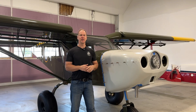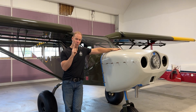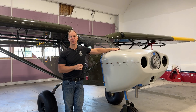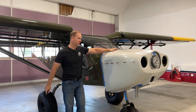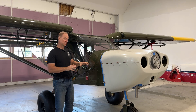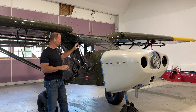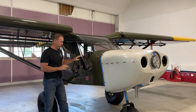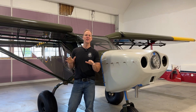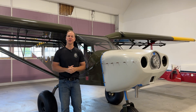When I remove the cowling we'll also talk about the oil pressure and fuel pressure sensors, which were not indicating correctly — I had one wire wired in incorrectly. The oil temperature sensor was a nightmare to get working because it wouldn't ground with the engine. Hopefully the info I give you on that will save you some headache. We'll also cover everything from the firewall back: wiring for the intercom, the windshield is on and sealed, the doors are done, I did have to remove and modify both doors, the rear seat is in, and all the wiring is done.